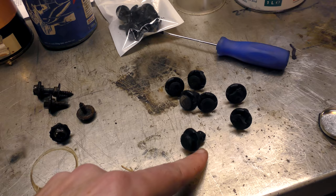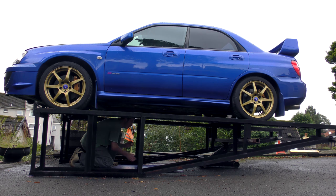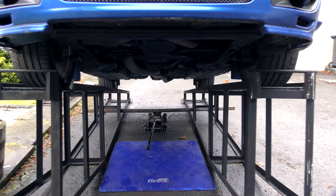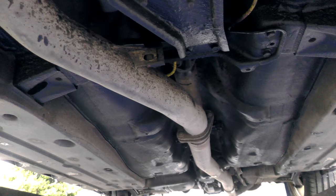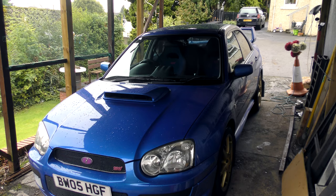I'm going to replace these with bolts of the correct size and some washers. Both under trays are on - I've got a new bolt in there, all copper greased up so it doesn't rust. That one snapped off, but the trim clips will hold everything else on. And everything else is wax oiled and Aqua Steeled - it's looking pretty good in here. So hopefully that will help stop the salt rusting it in the winter. That's the Subaru rust converted and undercoated, ready for winter. If you like this and you'd like to see more, please comment and subscribe. See you later guys!